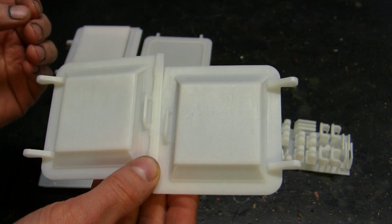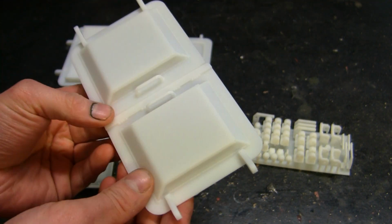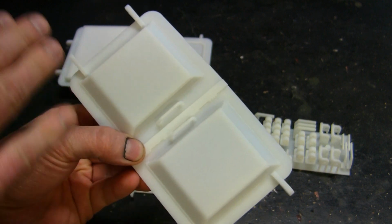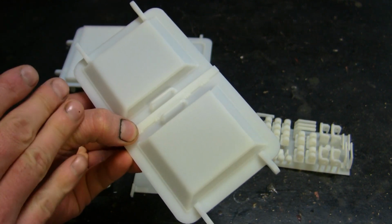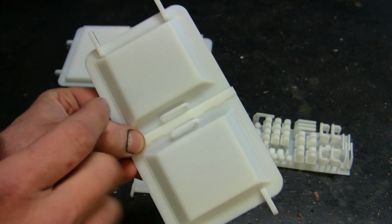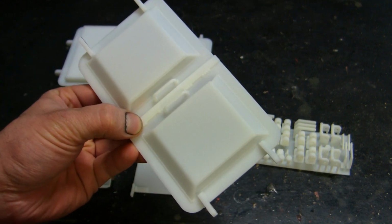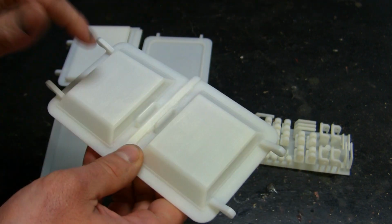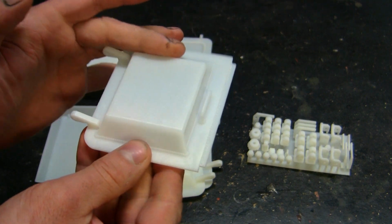However, some of the feedback that came back to the engineers from the troops was that the hatches left some room to be desired because of the propensity of the headroom, or I should say lack thereof. With the driver all buttoned up on the inside, he has a CVC helmet. This adds a little bit to the space, and with the hatches fully closed, this created a bit of a problem for the crew on the inside. So the engineers at Cadillac Gage went ahead and redesigned the hatches in the following format, where they added this blister section to the middle section.